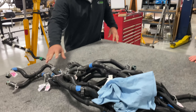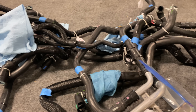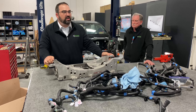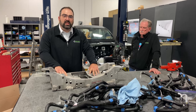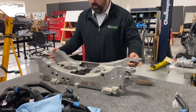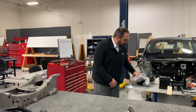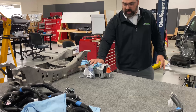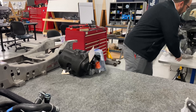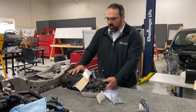There are actually 35 different hoses on the Mach-E, which is a very large number when looking at the thermal system. Pulling out a few other parts — we'll start with the bracket used for mounting most of this. This is the crosscar beam, which also holds the motor as well as the electronics. So Ford is doing more than just the thermal systems with this component. We also have the compressor that the Mach-E is using, and there is a noise-isolating diaper that goes around it, plus a bracket and an isolator to hold it in place.